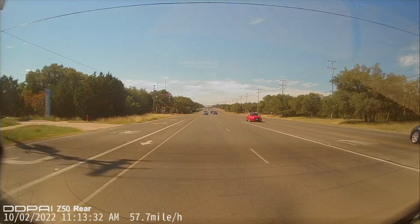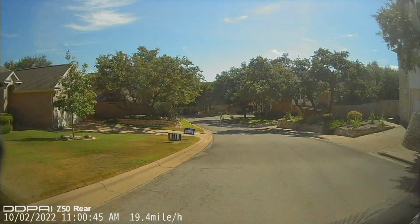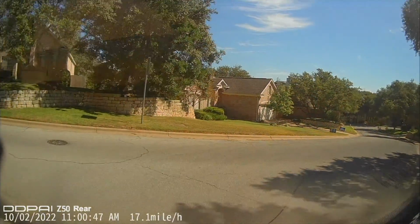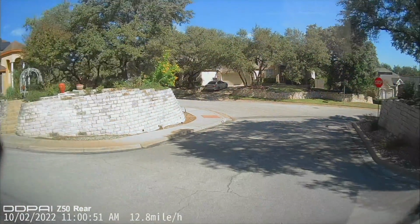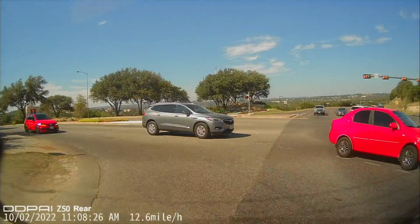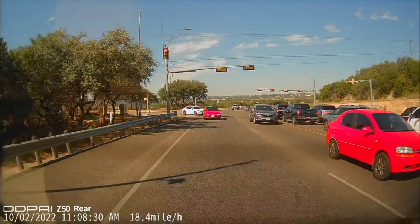The white balance isn't just off. As you can see here, it floats around rather rapidly like it's hunting for the right setting, and sometimes it actually holds a proper value for a while and things look normal, but inevitably it'll start moving all over the place and it usually ends up looking kind of orange again.